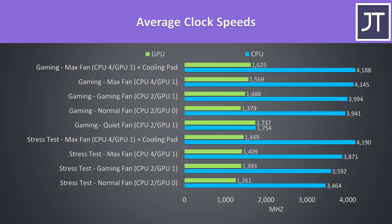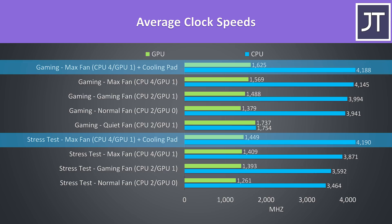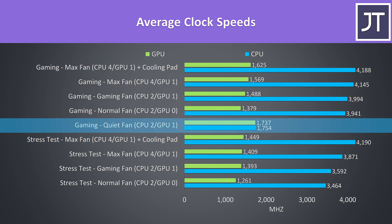These are the average clock speeds while running the same tests. Keep in mind this is an 8 core CPU, so the fact we can hit 4.2GHz on all 8 cores both while gaming and under this combined CPU and GPU stress test is quite impressive when you consider I can't undervolt. Intel XTU reported the 10875H as having a 4.3GHz all core turbo boost speed, however mine didn't appear to go above 4.2GHz. Interestingly, the GPU performance was higher with the quiet fan profile in use, as the CPU being limited allows the GPU to stretch its legs.